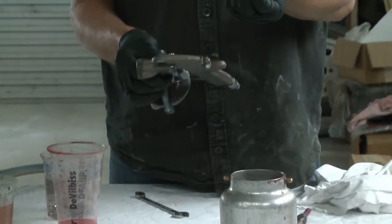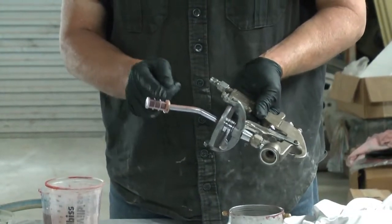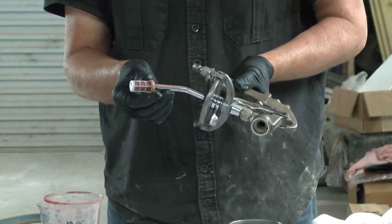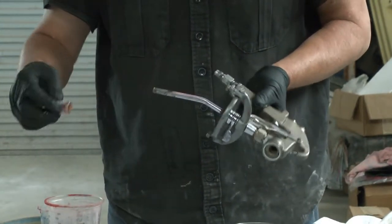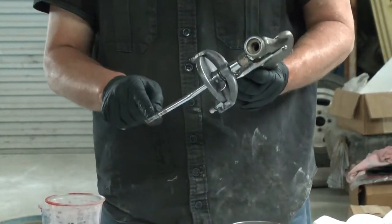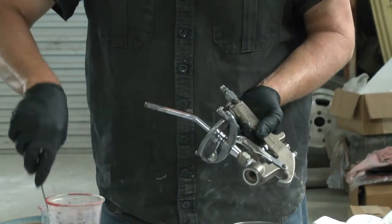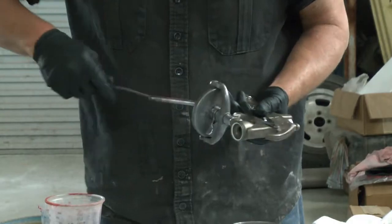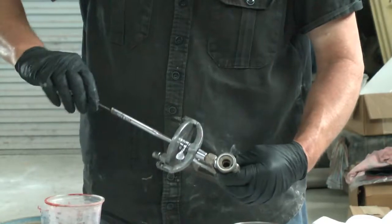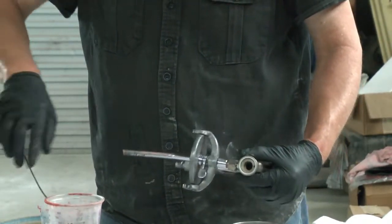Your last piece in here is the needle — that just comes out and gets popped in thinner. I've got a suction filter on the bottom. These are a screen — when you strain your paint out, if there are any foreign contaminants still in the pot, these will pick them up. Pull that off and give it a clean in the thinner. Now we've got nothing left in the spray gun — it's just an empty tube all the way up through into the head. So we need a long cleaning brush with a bit of thinner on it, and just push it all the way through until it comes right up inside the spray gun. You'll be able to see the end of the brush inside there. Give it a few twists, pull it back out, and that part's clean.